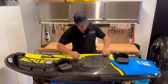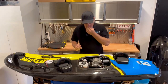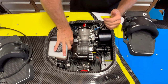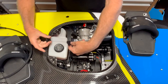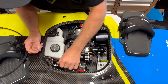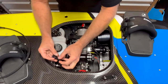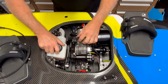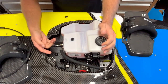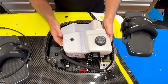Simply get the engine cover off — pretty straightforward as you would do anytime. First thing to do is remove the fuel tank. Really simple: there is a Velcro strap, easily removed. You've got a fuel line connector — just a little press button on the inside — and down below a fuel pump wire that you just unclip. Those have got a tiny little clip, very easy to remove. Then at the very rear you have the breather tube — just pull the fitting towards the tank and slide it out. Tank's out, piece of cake.